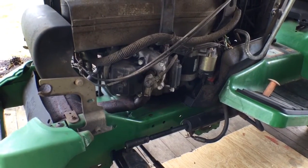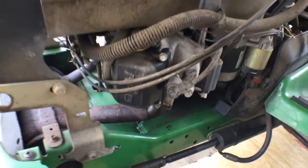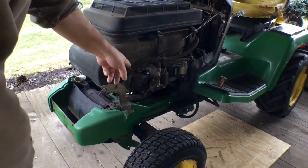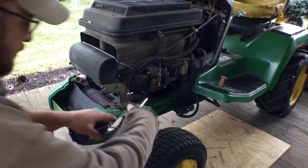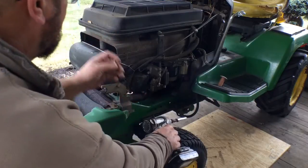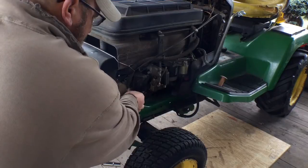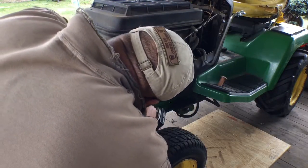So, we got that. So I'm going to tie the cables back, and pull that valve cover off, or rocker arm cover off. So I think I'm going to do that first. Okay, so I just took a piece of string and tied the cables back in the wire harness there. This is 10 millimeter bolts. The torque spec's apparently 53 inch-pounds. Put them back on.